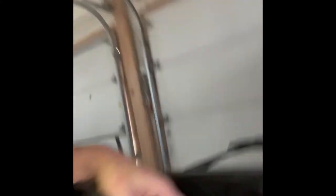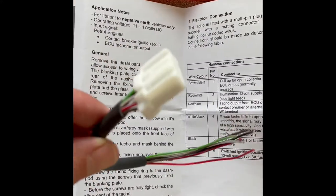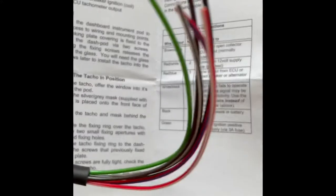I just want to look from the front and make sure I'm satisfied with the alignment. The tachometer comes with this wiring harness — I've plugged that in. This is the back of the instrument panel. There's the speedometer. What I'm showing here is this circle of ground connections. That red one with the red connector is the one I just added from the speedometer — I had to add about four inches of wire because it wouldn't reach, but that's where I chose to ground.